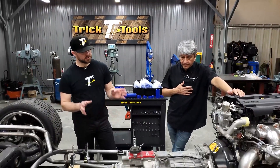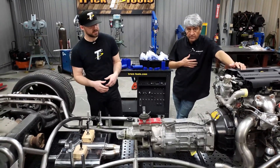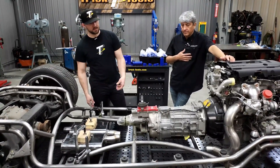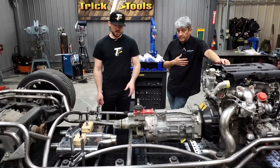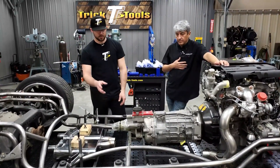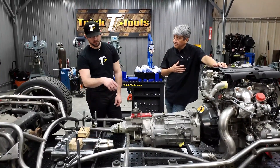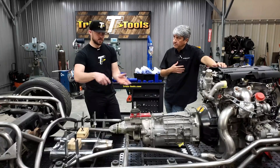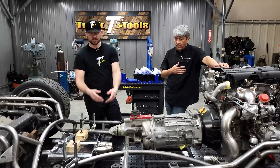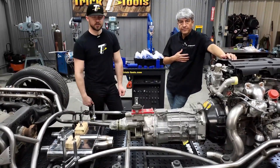We're going to be using the FE series modeling blocks to build up the exhaust system here on this chassis. We've got the down pipe already in place — it splits out into two and a half inches — and then we'll also have the start of an X-pipe here at the mufflers that we'll be joining into on the other end. We'll use the modeling blocks to show you how to get both ends out of the down pipe and how to join them together at the X-pipe.